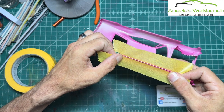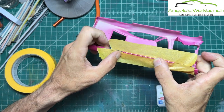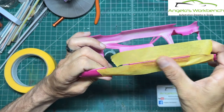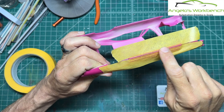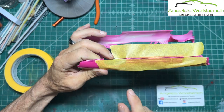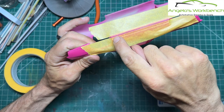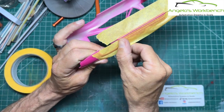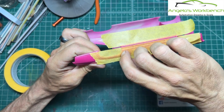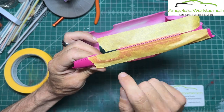I'm using my yellow frog tape to mask off the chrome trim, just burnishing it down with my fingernail. That is ready to go. Now I'm not going to worry about this end because that is chrome trim for around the wheel arch. I might be able to get a twofer out of this single piece of tape.